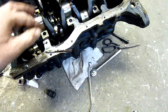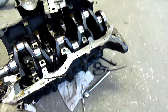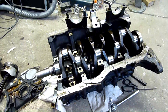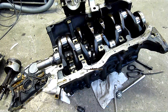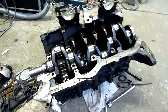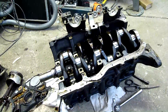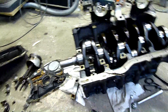It's only a standard FE block. It does have a GE crank which is scored - could possibly be cleaned up, it is a forged steel crank, but again there's no real point. It's not worth the money. I can get a GE front cut for about $2,000 delivered with a 3SGE BEAMS engine in it - the whole wiring loom, the ECU, the radiator, everything - just a front cut from Japan, complete and working with a 20,000k warranty. Not worth fixing. Kind of sad, but I got my fair share of spare parts out of it. Thanks for watching.